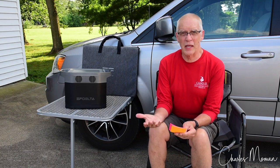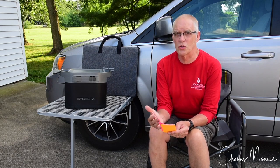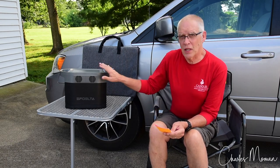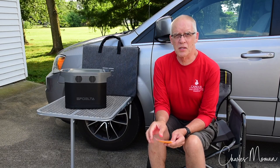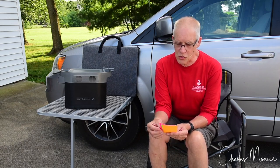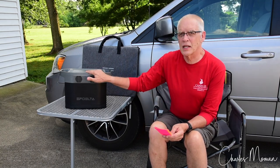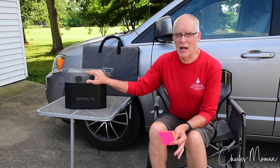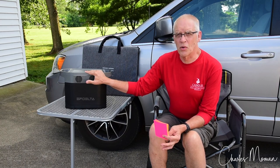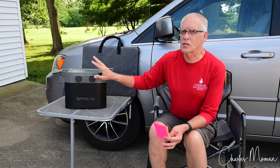I did a poll among Runaway Camper owners and most people said about 90% of the time they camp with shore power, but they still have the occasional need when road tripping for a lithium battery like this. Some campgrounds don't have shore power either. When you recharge this, it charges from zero to 80% in about an hour with AC power. I ran it from zero to 100% and it took an hour and 42 minutes. This is such a fast-charging lithium that it really gives you some serious options.